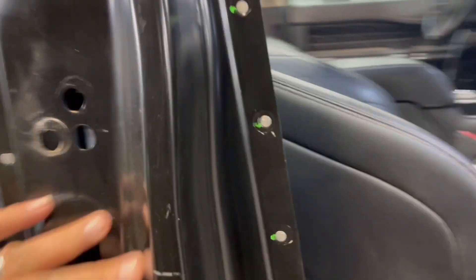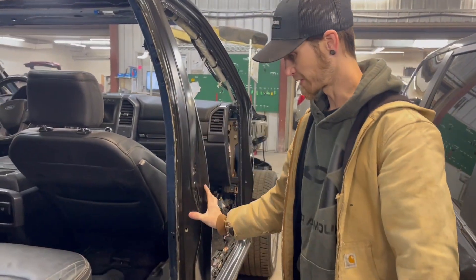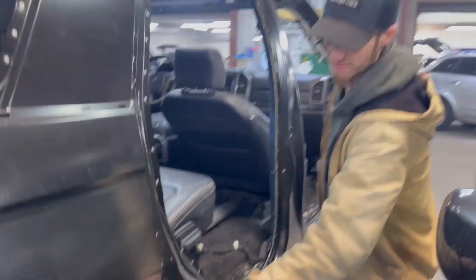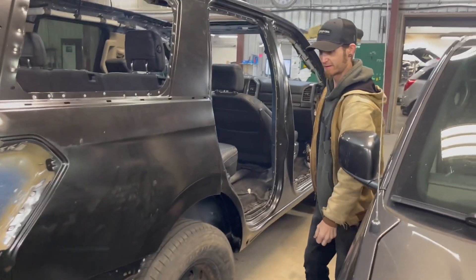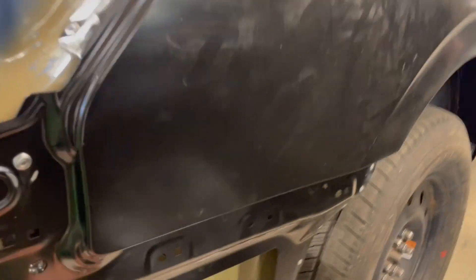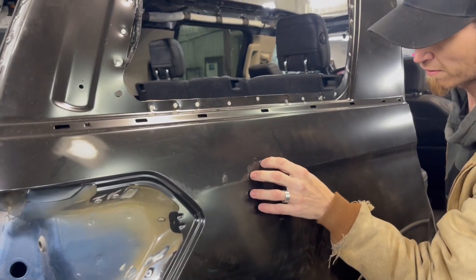Eddie, how many metals are in this, or did you have to replace any of the inner panels? I did the inner B-pillar reinforcement, the middle piece, the C-panel lower, the inner wheelhouse, and the inner quarter extension — that's a new piece as well. They were all black. I just did that to match the factory e-coat. So you spray this on to match the factory e-coat — there's no bare metal in the middle. This is the only sanding done: just scratching the e-coat a little. No Bondo or filler anywhere.